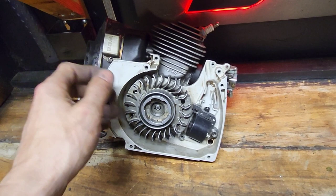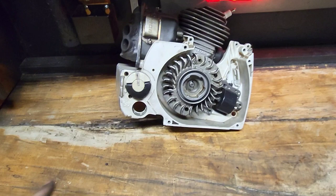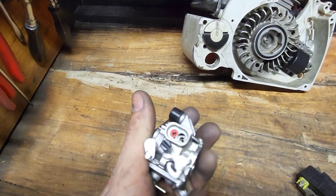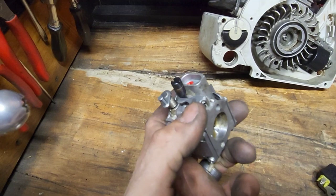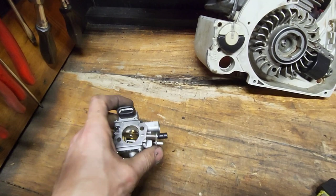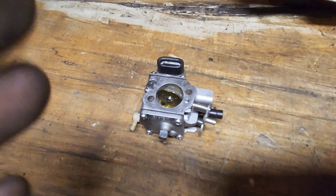Okay? So you're basically providing your air fuel mixture through your carb, and you're adjusting it with your, this one's missing a screw actually, but these are all just junk carbs. But anyway, you have your low and your high adjustments on your carburetor, your mechanical idle. I call this a mechanical idle because it just basically has a tapered end that pushes on your linkage for your throttle, and it's just going to prop that butterfly valve open a little bit. So that's how you're adjusting your fuel delivery, and that is done mechanically with, you know, a screwdriver.